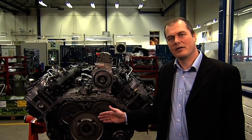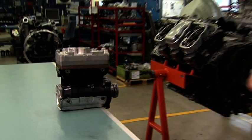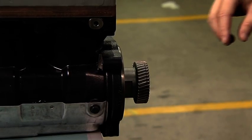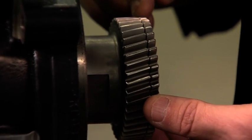There is one thing that we haven't seen in a Scania engine before: it is a scissor gear for the air compressor drive. The gear wheel is split, and this innovation keeps the noise level down.